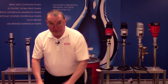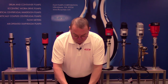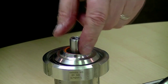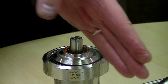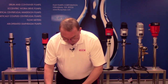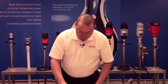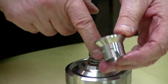The next thing you do is put your seal washer into your piece — into either your gearbox or the bearing housing if it's a 560s. Next, put your spring in. There's a small alignment pin inside the seal washer. I always put it at 12 o'clock so you can see where it is. It's important for alignment of the mechanical seal because the seal also has a slot which must line up with that pin.